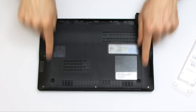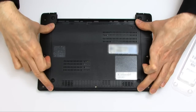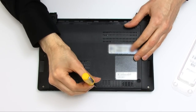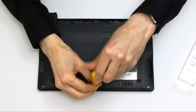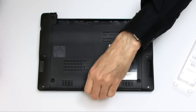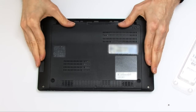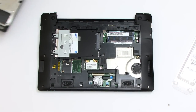Having done that, let's take it back upside down. We now need to remove the bottom panel. All laptops and netbooks will have some kind of panel on the bottom — this is quite a big one, some are smaller — but they'll all have some sort of panel. We just take out one screw here. Screw is out, and then with a gentle push we get the panel off the bottom, and there we are inside the machine.